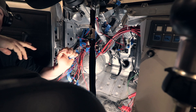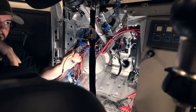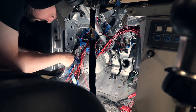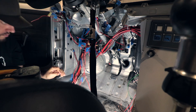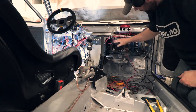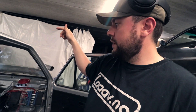These are the two wires coming from the engine bay. The only thing I have to do is connect one of them to a ground and the other one to the relay which the ECU is controlling. Now I have wired up the inside of the car. The only thing I need to do is change the ends of the wires in the engine bay and then connect it to the fan and check if it will work.